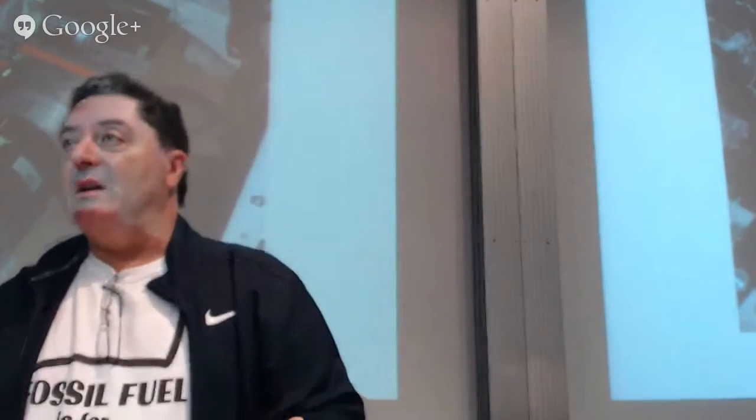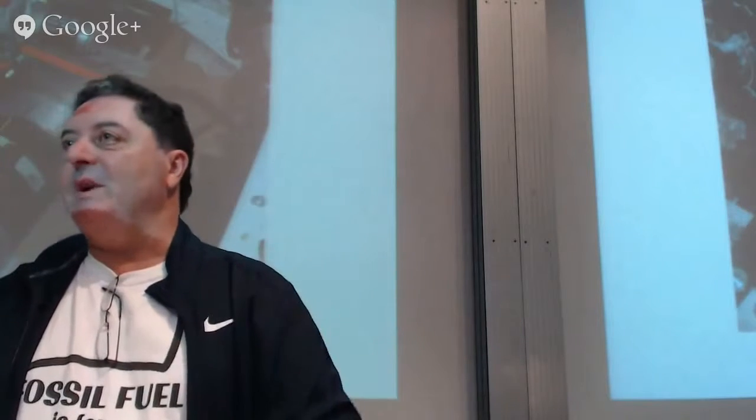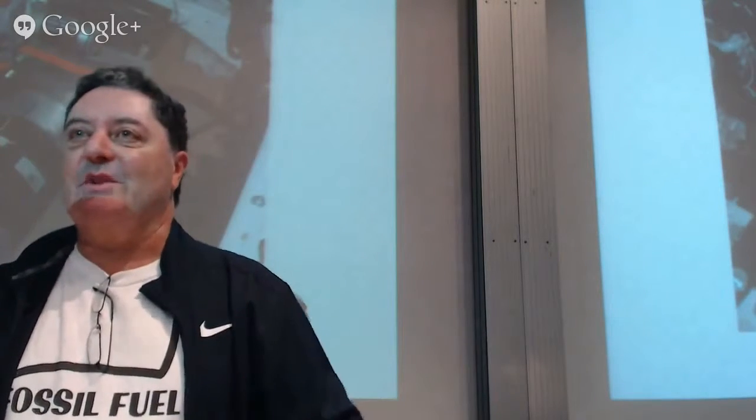But this talks about the vacuum pump, and there's an aluminium water bottle that we used as a reservoir for the vacuum pump, because the original pump worked off your internal combustion engine. As you moved along, it created a vacuum for your brake booster. Well, that's gone, so the vacuum pump does that job, and the bottle becomes a reservoir. That particular pump I haven't used. We took that off because we weren't happy with it. So the new pump there doesn't actually require a reservoir, but because we already had it, we've maintained it. So it's got a reservoir plus doesn't really need it, but it's there.